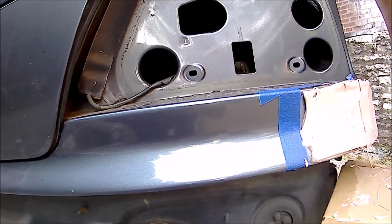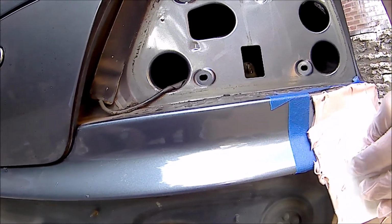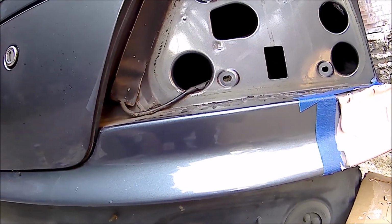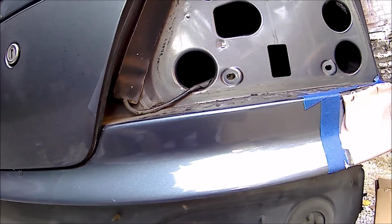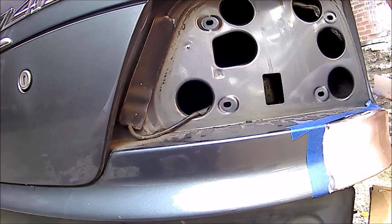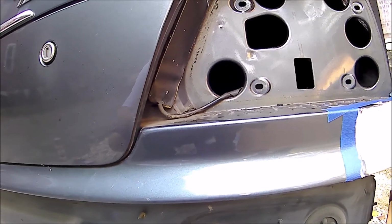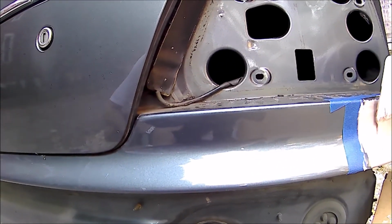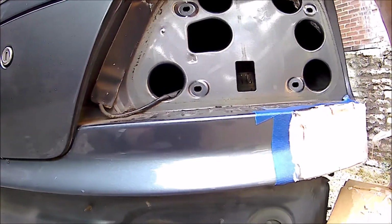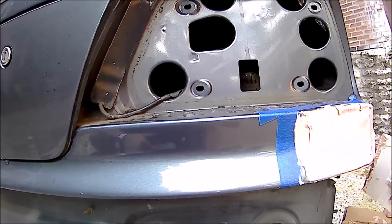Yeah, this stuff doesn't keep forever. It'll eventually dry out. Yeah, once we get this set, when it hardens, we'll finally sand it to the shape of this as best as we can, give it another coat, sand it again, and then once it's 100% perfect, prime it, and then she'll be ready for paint. So the stuff hardens quick, so you can't be playing around with it. Especially because I got a little too much hardener in it.